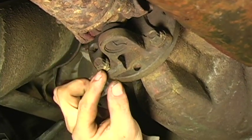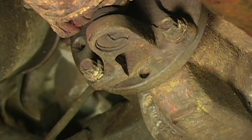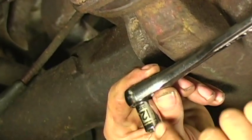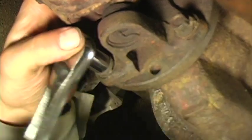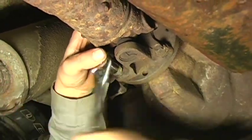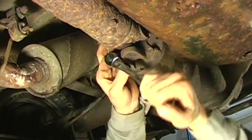As you can see, this is kind of a strange-looking bolt head there. That's going to take only a 12-point socket — it's a 12-point, 12-millimeter. I have my 3/8-inch drive ratchet. There are four of them, so let's go ahead and break them loose. It's okay at this point in time to take them all the way out. The bolts are your typical lefty-loosey, righty-tighty variety.